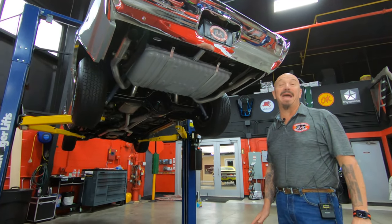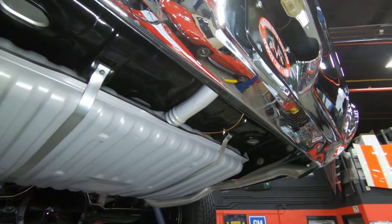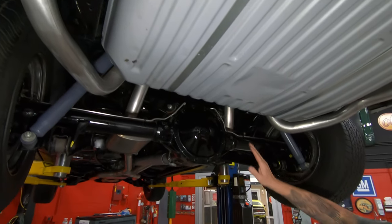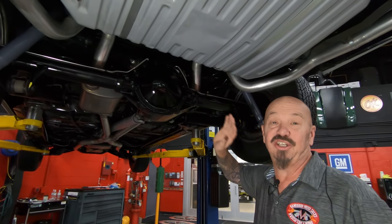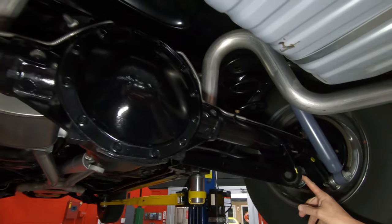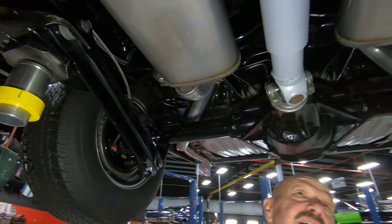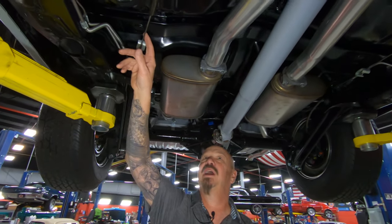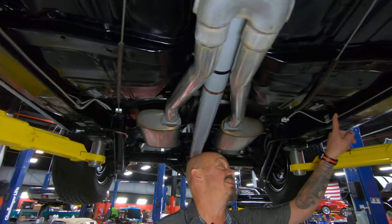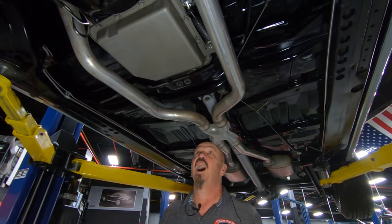All right, we're underneath the Olds now and man is it pretty under here. Look at that tank, look at the floorboard and the trunk — that bright black paint is looking sweet. All the body bushings are new. You can see the exhaust is new, all tucked up in there nice and neat. This 12-bolt Olds rear end has got a 2.60 gear — it's a great highway gear, and it is an open rear end. You can see new shocks, new bushings in the control arms top and bottom, new brake lines, and it looks like new drums on the brakes. The mufflers look brand new. Parking brake cable looks new. The fuel line, vapor line, and brake line all look new. These floors are just absolutely gorgeous. This car has definitely been on the rotisserie, all painted up. Turbo 350 trans.